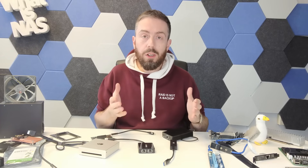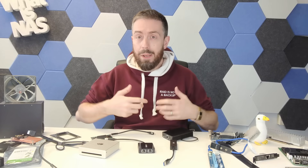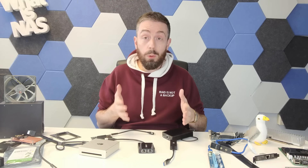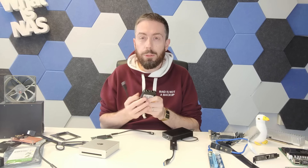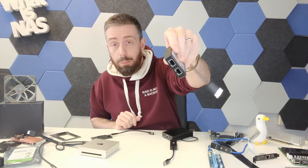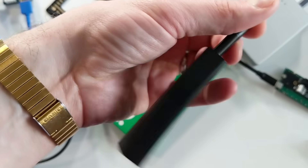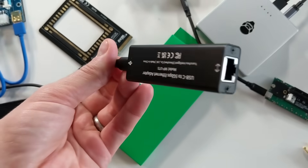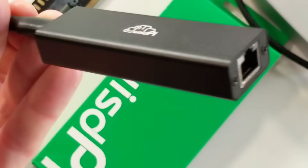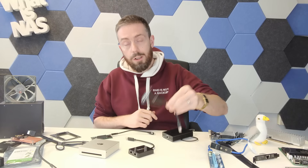Circling back to USB support — we're seeing more DIY NAS motherboards with USB on board, and USB 4 and Thunderbolt 4 are being slowly integrated into NAS. When it comes to USB network adapters, options weren't great historically. You can get USB to multi-port adapters, but support and compatibility is negligible. On the other hand, you can get USB to 5 gigabit adapters — this is a Wavlink USB to 5GbE adapter for about $30, which is half of 10GbE just by plugging in. Driver support is slowly growing, and I found a driver from a previous 2.5G adapter that worked in Unraid and even a patchy unofficial Synology build.